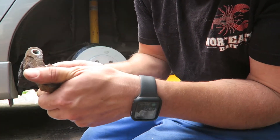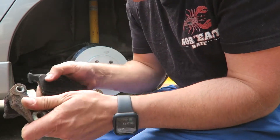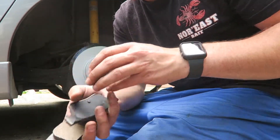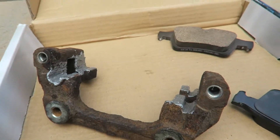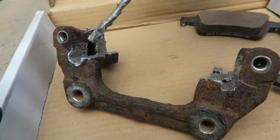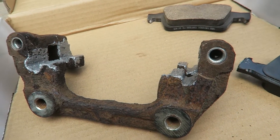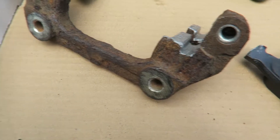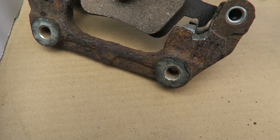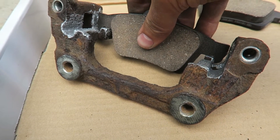It should go freely and it just doesn't — that's how brakes seize up. So we're probably going to Dremel some of these. After you shave it off, you can see it moves way more freely. Now we're applying anti-seize lubricant to any surface that will touch the little guides on these brake pads. Just put a little — a little goes a long way, you don't need to get too crazy with it. We have it right in the caliper bracket where the pads go. After shaving a little bit off, it moves pretty freely — so it's not going to seize up and ruin our pads.